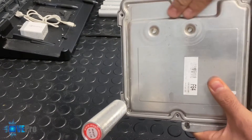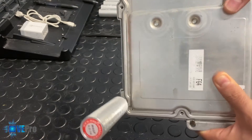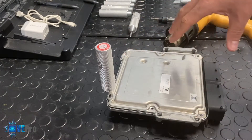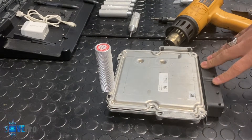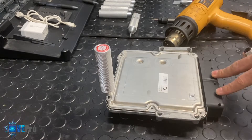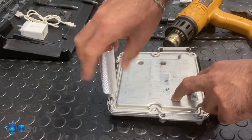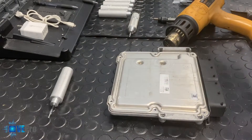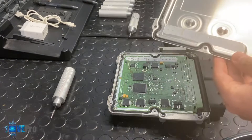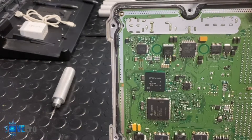Whenever you have this flat surface, there's high heat happening and it acts like a heat shrink. It's better to work from the other side because it's a thinner layer. With six extractors around, you apply the heat, you twist, and this helps tremendously in doing the job without needing a flat screwdriver, which could cause bent areas or damage inside the board. Once you can see the silicone, use your exacto knife to cut through, then complete the process. Once it opens up, everything's clean, nothing's bent, and you can apply silicone again to close it off. We now have access to the ECU board.